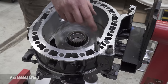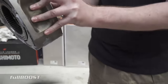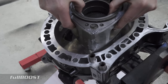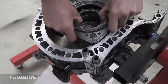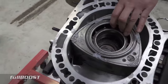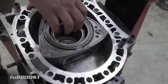Next step is to throw the rotor in. There is no right or wrong way or wrong location to put this in. Essentially the front is here, the gear is obviously there. It's just a case of putting this down here and it will just locate on the gear. You can see it's sort of falling there, but once I put the eccentric shaft in here, it will locate that in place and then that's fixed. Now it's time to get the shaft in there.